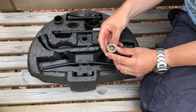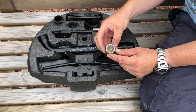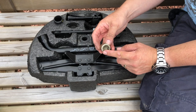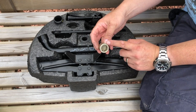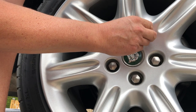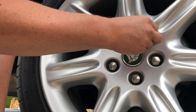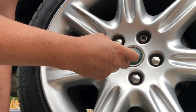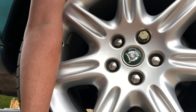Next item is the locking wheel nut key. This is what's used to remove the locking wheel nut and it has two, occasionally three, barbs in different positions. There's a decent number of combinations before you get back to the same design — certainly not infinite, but a decently effective anti-theft device with enough structural strength to actually remove the nut.